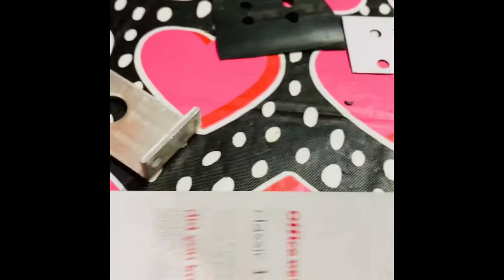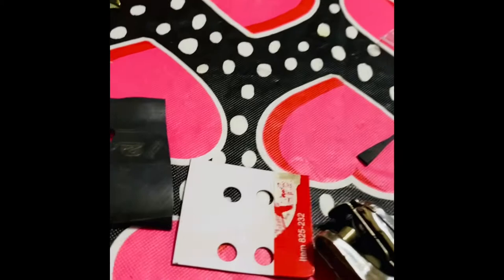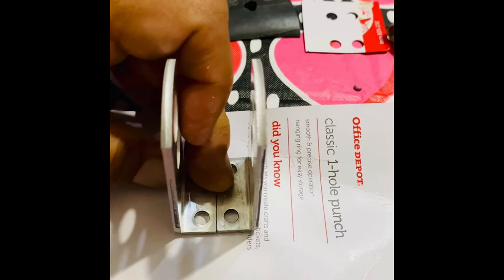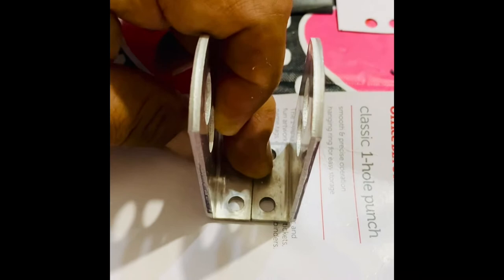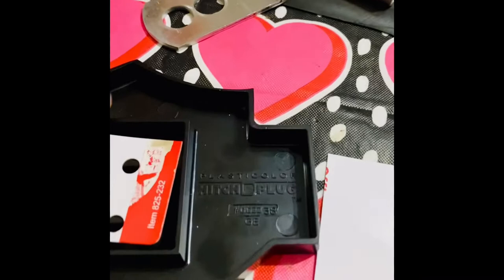This is how I made a jig. I ended up getting some cardboard. As long as these two pieces are sitting together flat, you'll get the template you need to drill the holes out on your brake pedal once you remove the factory ones. The line needs to go vertically — not horizontally. Do not have them sideways or it'll go wrong. Once you have them set together, mark your holes and punch them out.